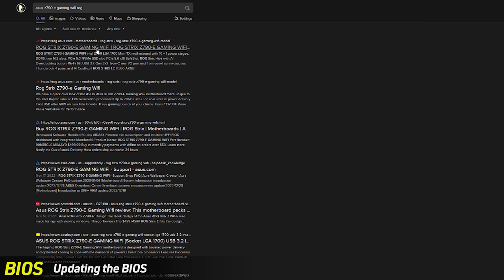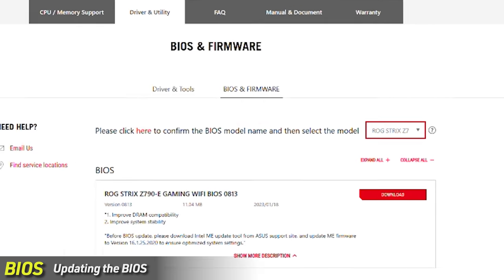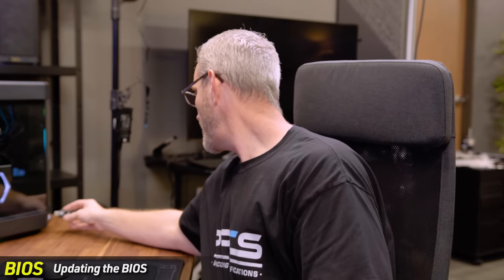Take your second USB drive, find the model of your motherboard, and on another system — a laptop or even a Chromebook — go to the manufacturer's latest BIOS page and download the latest BIOS. The one we're installing actually had an update eight days ago, much newer than when we built this system. The changelogs will tell you exactly what changed. Most of the time you'll see general stability fixes and memory compatibility updates, because memory is churning out fast right now — and this is a DDR5 system.